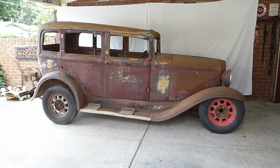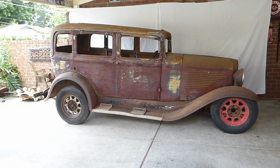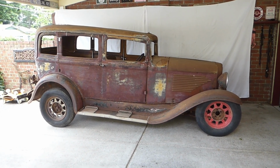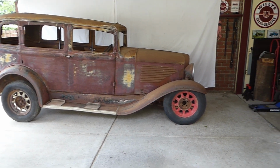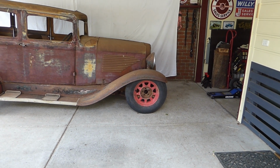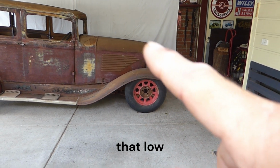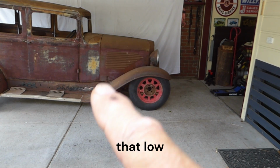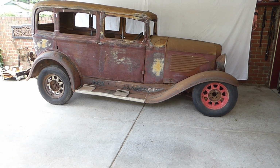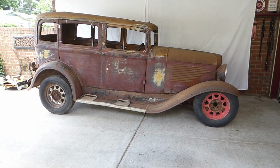Alright, I've lowered the front down from 12.5 inches down to 8 inches, and don't forget I can go as low as 4 inches with the suspension stock from the 300. Well, you wouldn't get a taller tyre under there, that's for sure. It's already tucked up under there. If we decide to go that high, then I will arch up the whole middle of the guard up and over it, which I reckon will look cool. But well, the front's down, and talk about hot rod rake. Now I'm going to lower the rear.